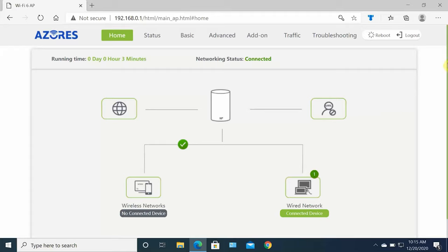Now let's look at the router admin setup. Azores designed the Wi-Fi 6 router setup as a simple three-step process. Download the Azores router app on Android or iOS, connect your router to your modem — or connect the WAN port directly to your ethernet cable if you have fiber and don't need a modem — then follow the app instructions to complete setup. You can also set up using a web browser, which has a very clean interface with a ton of options.